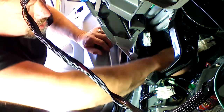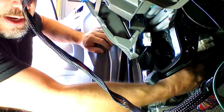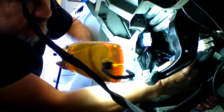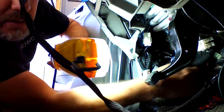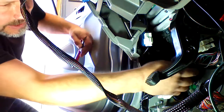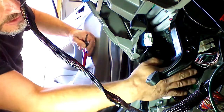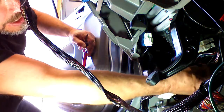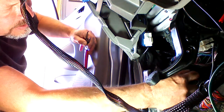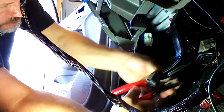We're looking for the wires that come through the door boot right here up in the back. So you can see them right here. That's where we'll make our lock and unlock connections. Okay, we've located our lock and unlock wires. We're looking at these small dark green and gray. We've tested them with a test light to make sure that they're lock and unlock. When probing them with a negative, they will actuate.